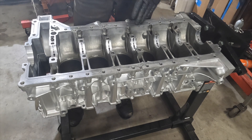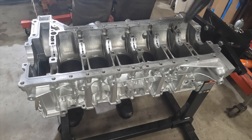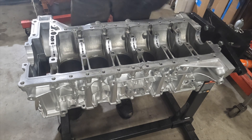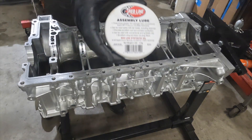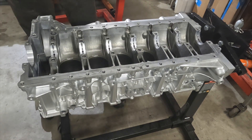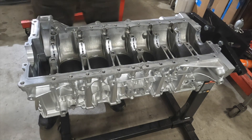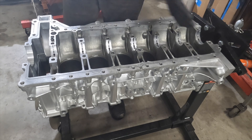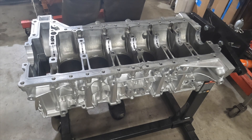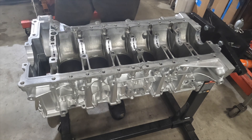So now we're going to go ahead and install the crankshaft. We'll check our axial clearance, we'll lube it up with some Redline Assembly Lube — this is what I'm using here for assembly lube. We're going to lube it up, install the crankshaft, check our axial clearance, check our breakaway torque on our rolling resistance. Okay, let's get to it.